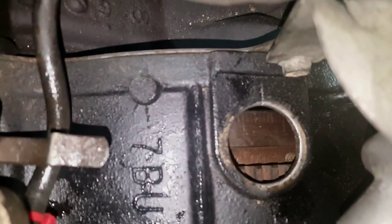I'm back. Now that I've got the valve cover on, let me put this back up here. Make sure the plugs are in tight. I've got the fuel pump back on. Now, the distributor rotor is currently up here with timing at the seven degree mark — that's because it's in the intake phase. When you do your timing, you want piston one in the compression stage, so that's what the two valves being loose — making that little rattling noise — indicates. And then you should be lined up.